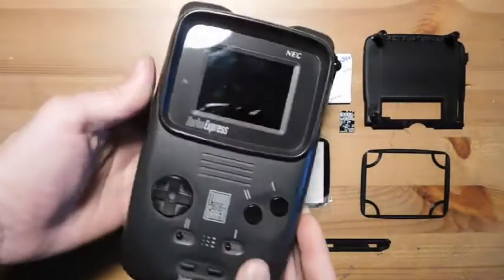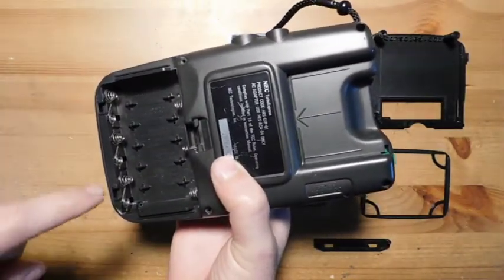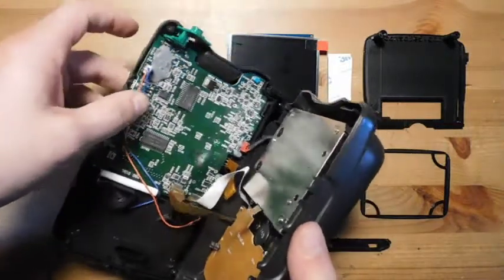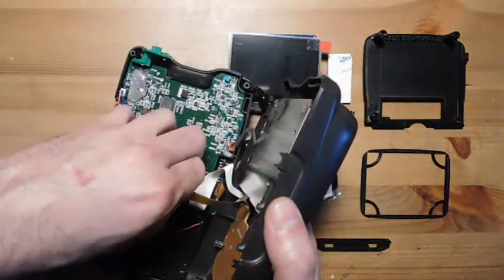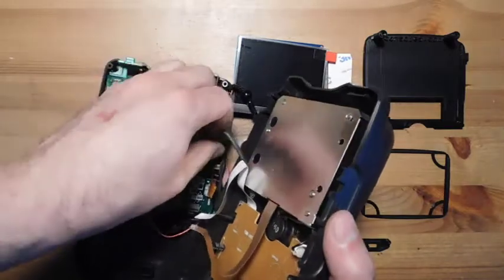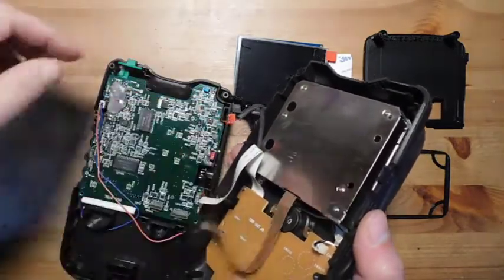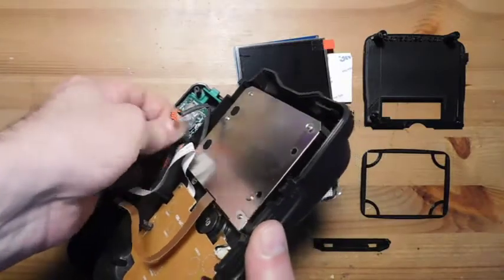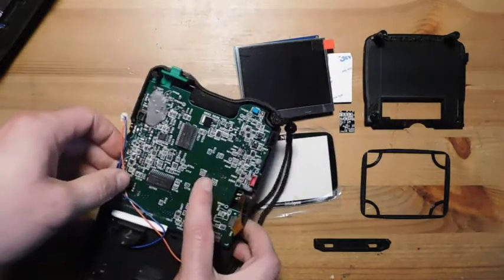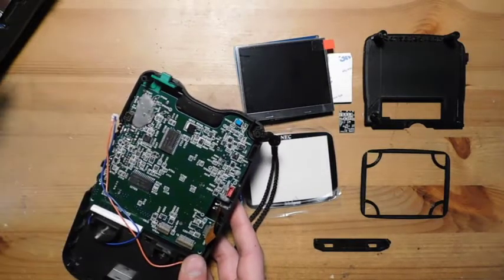The first thing you've got to do is take apart the Turbo Express, and this is simple. I covered it in my previous video, which I'm going to provide a link to later on. You have six Phillips screws to pull out. Once you do that, it opens up like this, and you have a couple of ribbon cables to disconnect. This one is for the original screen, this one is for the speaker and the controller pad, and this one powers the original screen. Some of these connections are no longer needed, so those two are going to come out. Then there's a connection for the battery terminals, and that's basically it. I'm going to set this part aside for now, because the first thing we're going to do is install the composite mod onto this board, and then test it out before we bother starting to cut open the case.